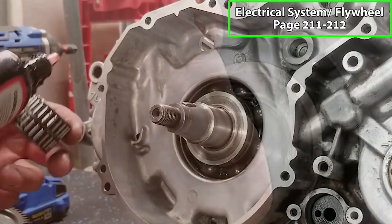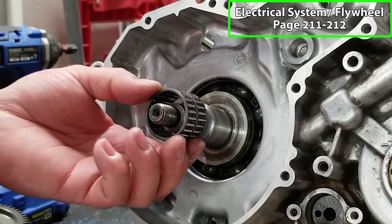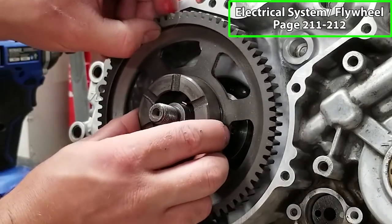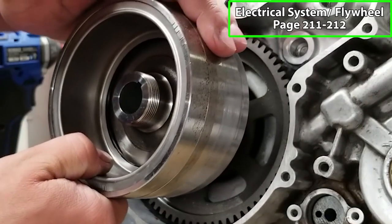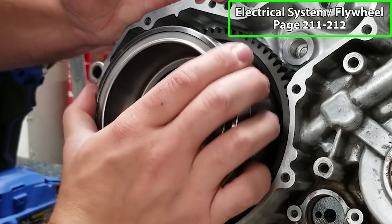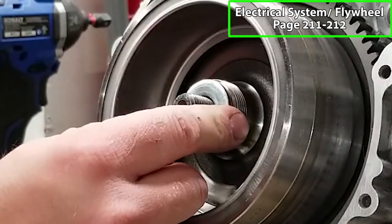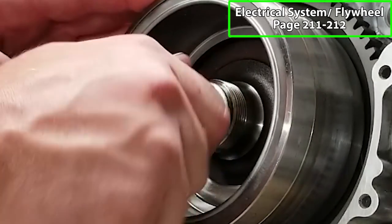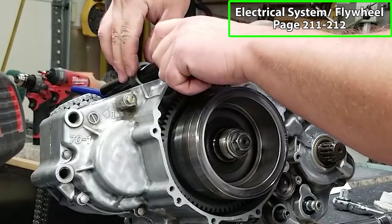so you know that your key is sitting all the way in there. All right, with our key in there, we've got a bearing that goes in place. Put our starter gear in and our flywheel. Oh yeah. We've got a washer that goes on here, a little bit of red Loctite. Spin our nut on. Now the flywheel gets tightened to 110 foot pounds